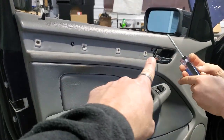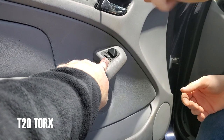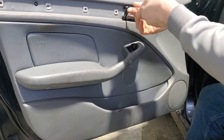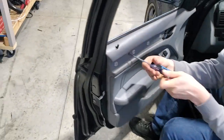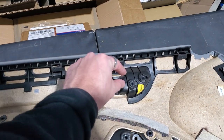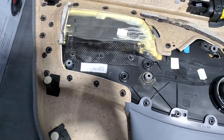There are two screws — one, two — up there. The big difference between these doors is you're also going to have one down here, and then behind this little piece you pop that out and there's another one. On the coupe doors there's a tab that pops out with another one hidden behind it, but this is a sedan door so it's a bit different. Those are all the screws you need to remove to pop the door panel off.